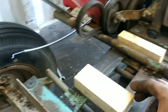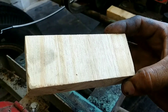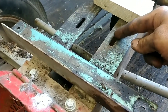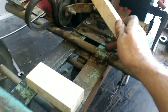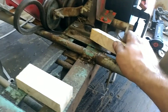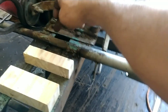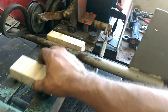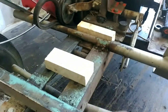So what I'm going to do — I'd love to have metal risers but I don't, so I just cut some one-inch pine. And bonus: the factory frame rails have adjustment holes that actually line up with the Predator motor holes. It's not crazy that something made in the 60s lines up. There's nothing in the rear though — my steering box is in the way — so I'm just going to drill two new holes. I need to mark four holes and drill through the wood, but if I drill two permanent holes back there, there's no adjustment, so I have to get it right the first time.